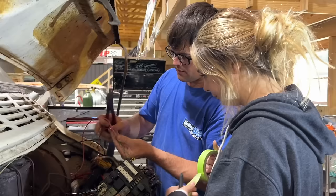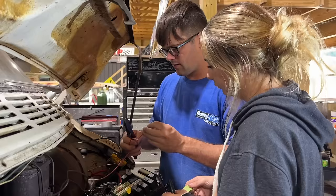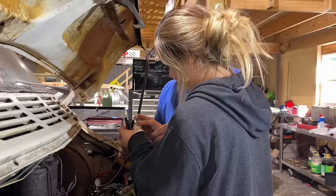These are our two power wires, basically our ignition power. So one of these has power in cranking only, and one has power when the key's on. We're gonna have to reuse these definitely when we power up this thing. Label that one ignition power, okay?